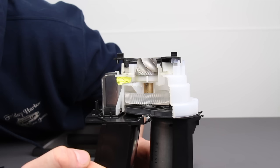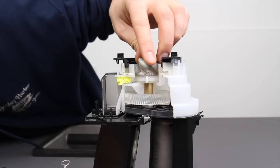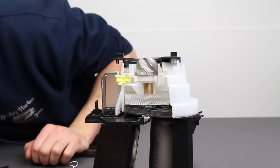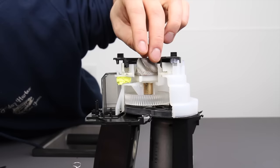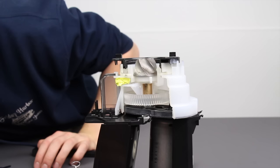What happens is coffee gets packed in the hallway and prevents anything from going through it. I simulated that with a yellow sticky note so you can see where the problem is. The grinder is able to run and spin, but the paddle wheel tries to push coffee through and can't because it's blocked with packed coffee. This is why the grinder runs and sounds totally fine — it's not doing any work, it can't pull any more coffee in. Sometimes it sounds loaded down, but most of the time it just sounds like it's running empty of beans.